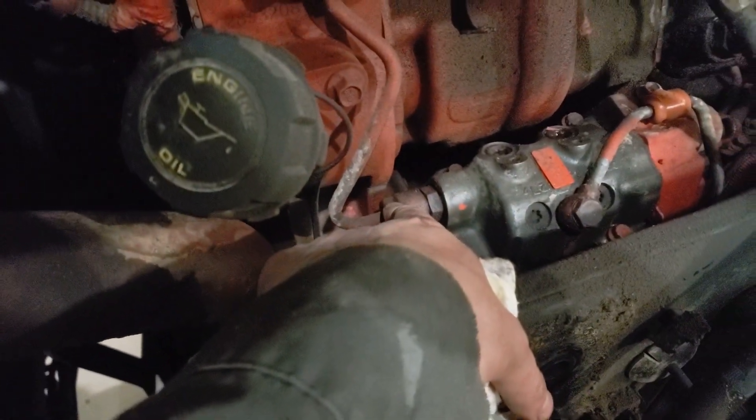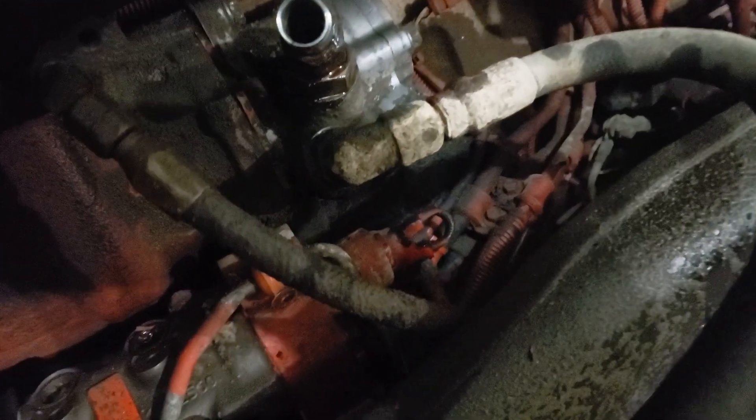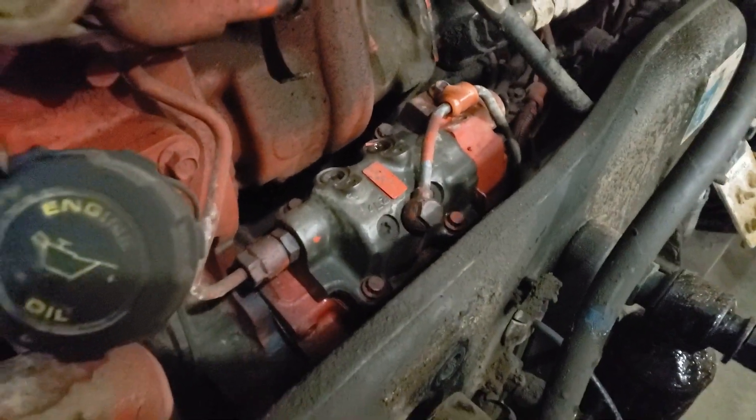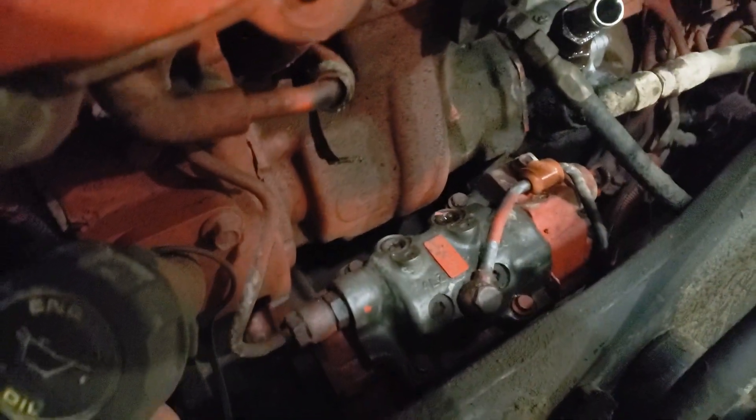Here's the fuel pump head. I'm going to take off the high pressure line here — I believe that's a low pressure feed line. There's a plug-in on the back of the regulator solenoid and then 1, 2, 3, 4 bolts — those are 12-point head bolts. So I'm going to get those things removed and then we'll be able to lift it out of there.